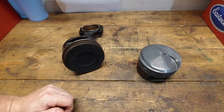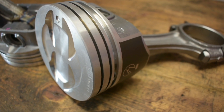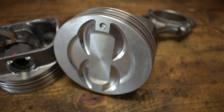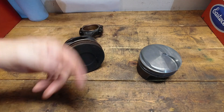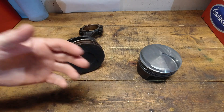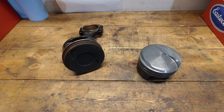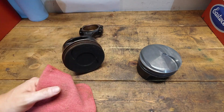The GMC truck is getting a good hypereutectic piston because it's not going to be a very big horsepower application — it's a very mild, torquey cruiser and that's it. If you have any questions on material type on forged pistons, or maybe a piston choice for what you're working on, please leave your questions down below — I'd be happy to answer them. And if you're not quite sure, pick up the phone, call or email your favorite piston manufacturer and they'll tell you what's best. We'll catch you guys on the next one.